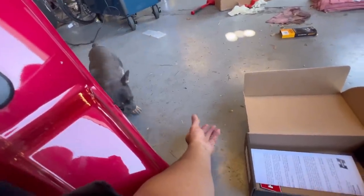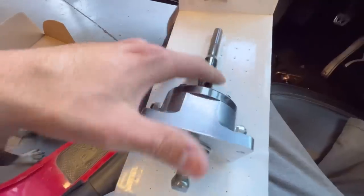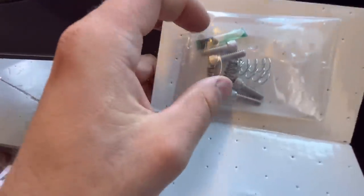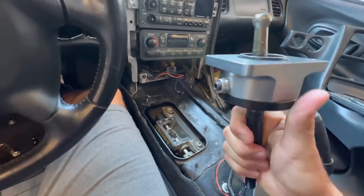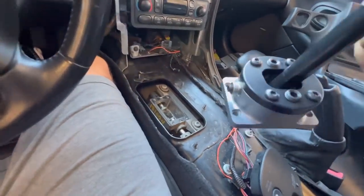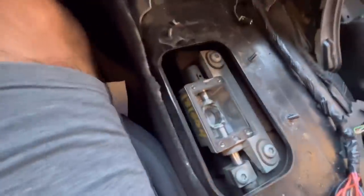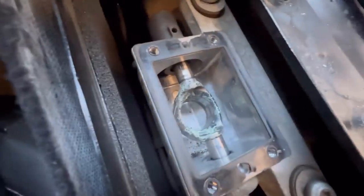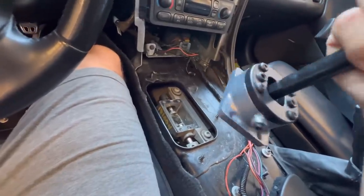Come here, my little baby — she's tired right now. Shelby, look at me. So cute. So we're going to get this new shifter unboxed. It looks like this plate is a lot thicker than the OEM one, so it looks like we do have longer bolts to go in. The springs — I just have to see how they sit inside the shifter. Looking at it, it does already have springs in here and they feel pretty heavy, so I'm going to leave them as-is, and if I feel like I want to go heavier, I'll go heavier. All I have to do is adjust this collar to wherever the gear stops, and then I'm ready to drop this in. I also see that there's a slot here — I guess I just have to figure out what's what.